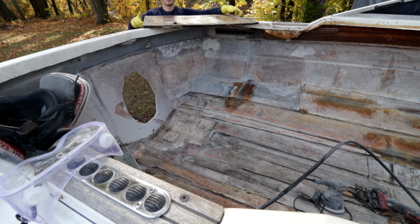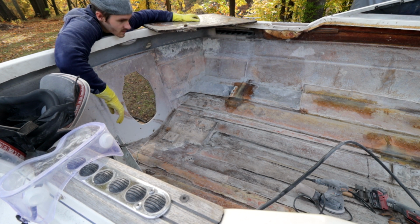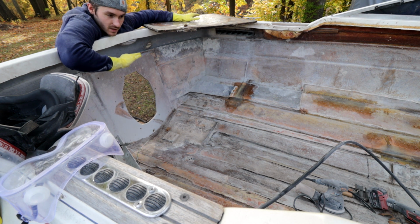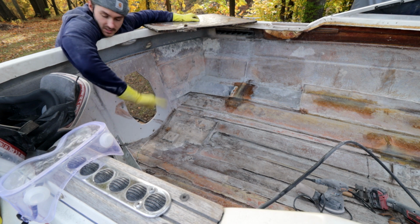So what we're gonna do, guys, is use this board as a pre-wetting station. We'll wet the glass on this and then lay it on the hole so that it's nice and saturated already. I wonder if that's going to help us with air pockets and stuff. Yeah, for sure will. Keep the air pockets down. Wet it on here, then wet that, then lay it, then tap it down and try to work from the center out to the edges to get all the air out.